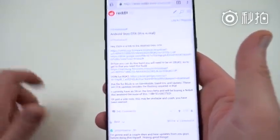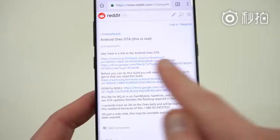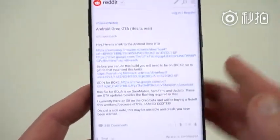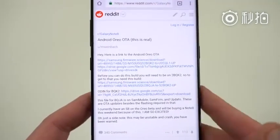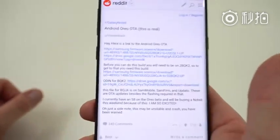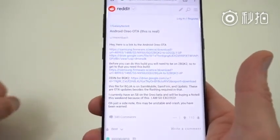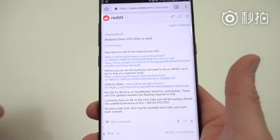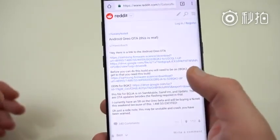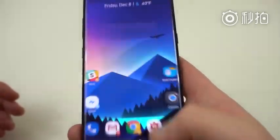Save it to your SD card. The other file, which is the actual Oreo update, is up here in this top link. Go ahead and tap on that Google Drive file and download that as well. That's going to be a fairly large file — 1.4 gigabytes. That is the actual Oreo beta update. We're actually going to have to flash two of these using the Samsung recovery mode, stock recovery. You don't need a custom recovery, root, or anything. So save both files — 2BQK2 and the Oreo file — to your SD card.